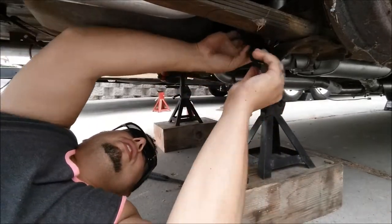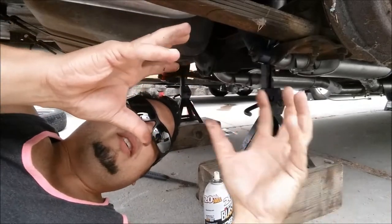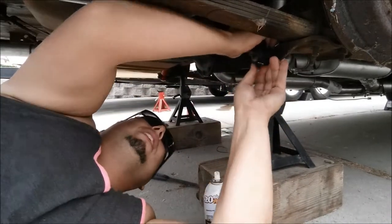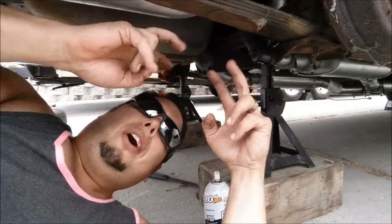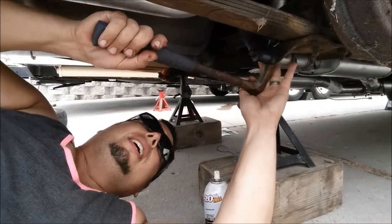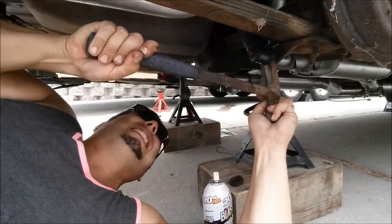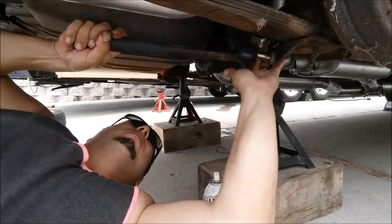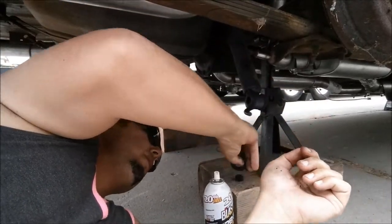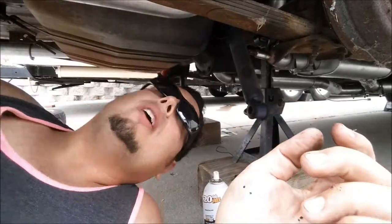Know that the shock is always going to want to expand, so be careful. There's a metal curved washer on each side of it — you can see how it's curved — and it goes: nut, curved washer, then into the bushing that's built inside the bottom of the shock absorber, then the other curved washer, both towards the bushing. The really hardest part of this whole thing, once you've wrestled with the lugs, is just popping this thing off. There's a little pressure in the shock unless it's totally busted, but a little fight using the metal curved washer and it should pop off. You can see both curved washers hug the bushing and the nut secures it onto the bolt.